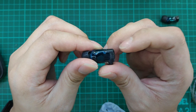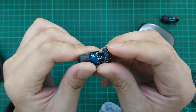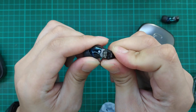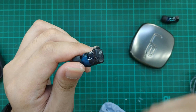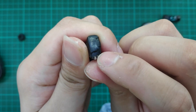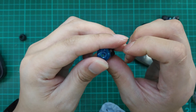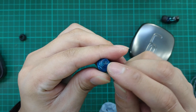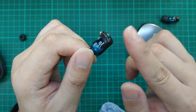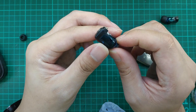Just take a look at the plastic — it starts here and ends at the other side. This soft rubber was soft until it hardened and started to crack. They are actually covering up a hard piece inside, so it's actually very safe to remove all the soft rubber. As we can see, the TF10 has two dampers inside. We have this nozzle, the back housing, and the connector. This TF10 is a triple driver setup. It's a very old IEM already.